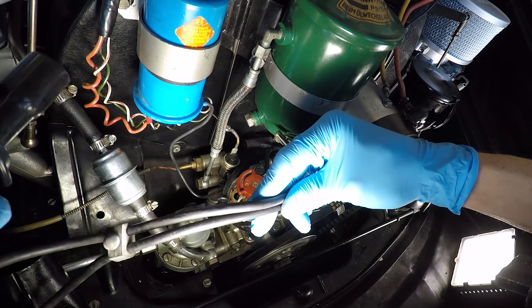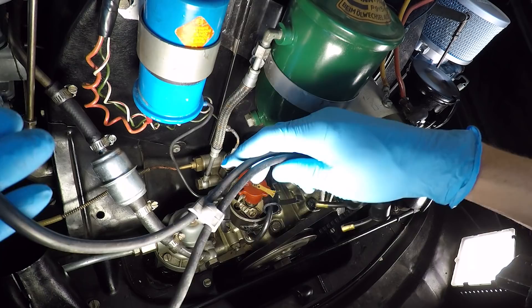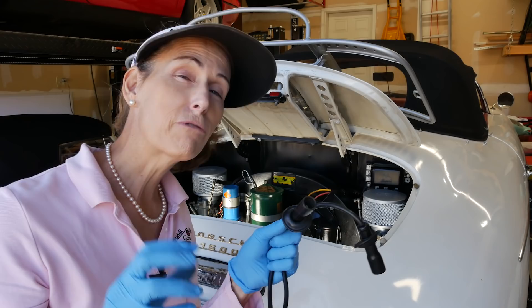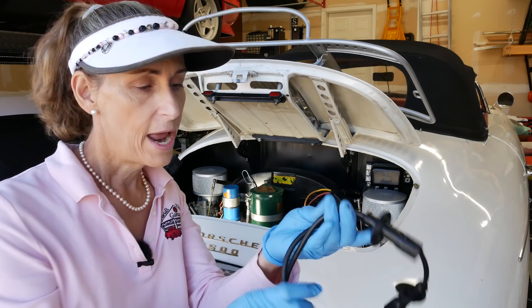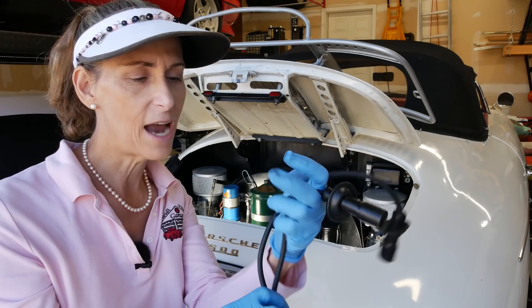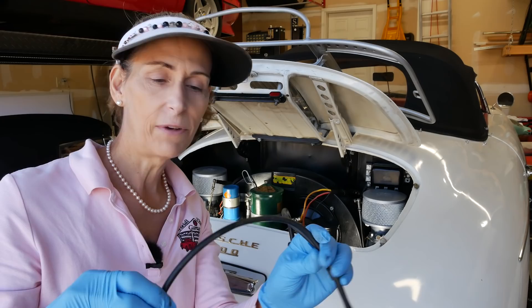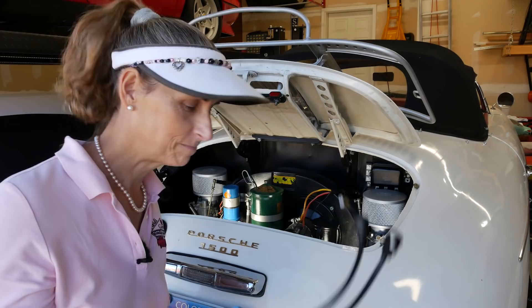Be careful pulling everything out and inspect our wires. They look fine, they really don't look that bad, but they were going off like crazy. Many times you just can't tell by looking at them. This is the first set on the left side of the car — cylinders number three and four. Remember, number three spark plug was super sooty and dirty. There's a very good chance this is really the issue. You can inspect these wires pretty carefully and not see anything wrong. So replace these wires even if they don't look bad if you're seeing any arcing at night — use Jack's method, it works great.